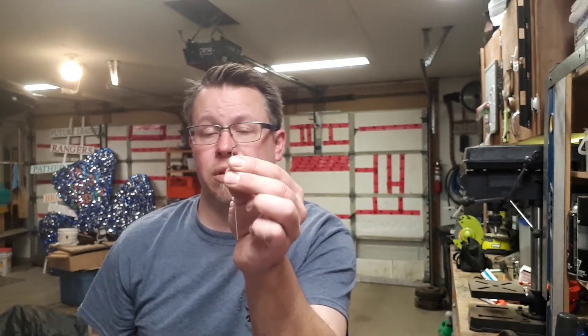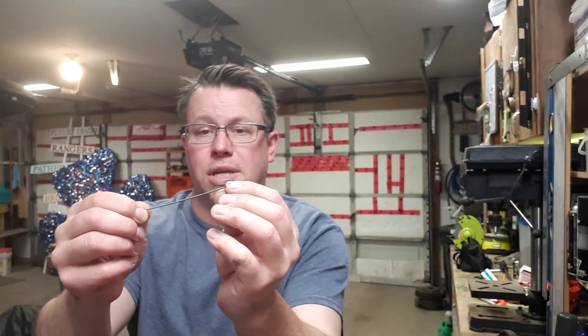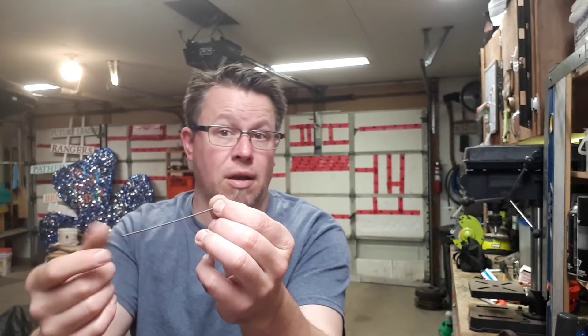It occurred to me that I could get the pattern for the governor link from Scott. The cheapest I was able to find a governor link from Briggs and Stratton - which of course is a discontinued part - was about 11 bucks, and then 20-odd bucks to ship it, for basically a piece of piano wire with two bends in it, three inches long. So I'm going to bend this up and make a part out of some scrap wire I had around, and it will cost me zero dollars.